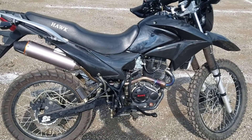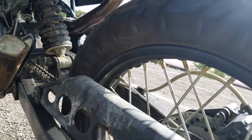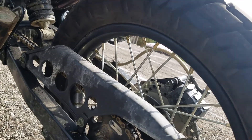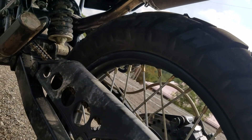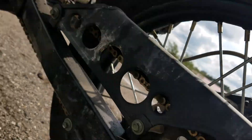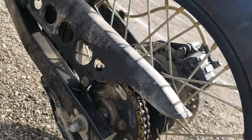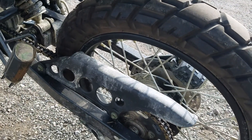I've been really happy with this bike — I really don't have any complaints. The back sprocket from older models would reportedly come off while driving, which could be very dangerous. I've never had any problems, but I did swap it out almost instantly — maybe 10 miles with the stock sprocket. Maybe that saved me, or maybe the 2019 model just fixed that problem. The only thing holding that sprocket in is a snap ring; the bolts are just cushions, so it's a bit of a weird design — but over a thousand miles now, no problems.